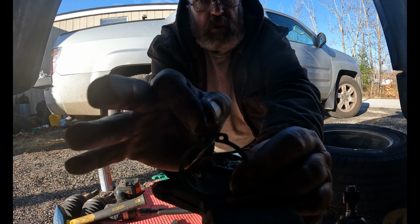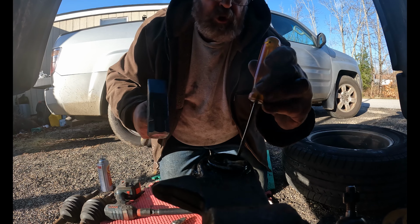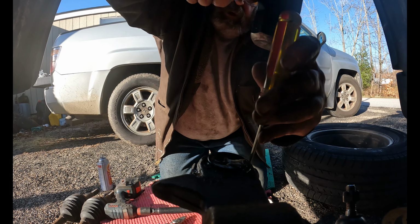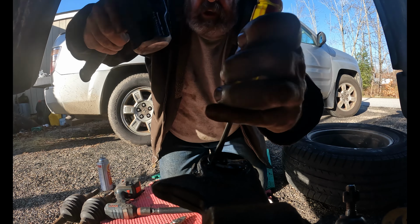the outer part, and then it closes down, and then you just want to make sure that that snap ring seats into the groove. You can take a little screwdriver or a punch, just tap it down, make sure it's down all the way. And it should just snap in. And there we go. Okay, to put the upper ball joints in, basically the same process.